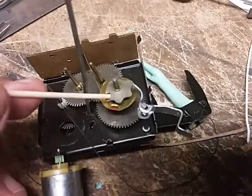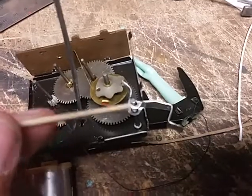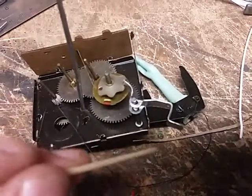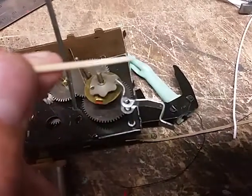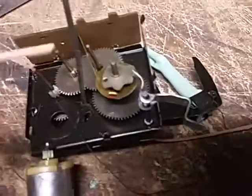This one has the cam that controls the box shaking movement that rubs against that, and also, as it goes around, it has a tab on the other end that drives the hand up, and then when it reaches the point of no return, it snaps back.